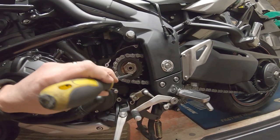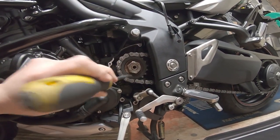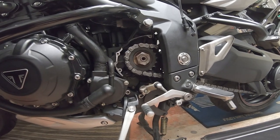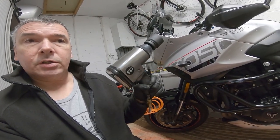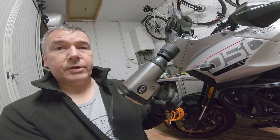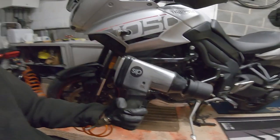I've hammered that flat and now I'll get my socket on it and see if I can make it budge. To get the sprocket nut off — I already did that, forgot to film it — but this is what you want: you can either buy an electric cordless impact driver, or this is just one that hooks onto a compressor. Buying one of these guns is about 25 quid with a couple of sockets, but you have to buy the right size one for your front sprocket.